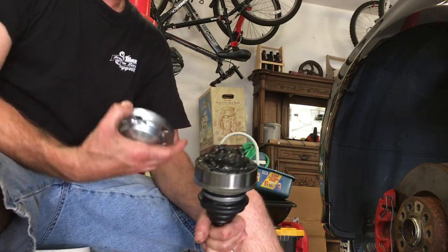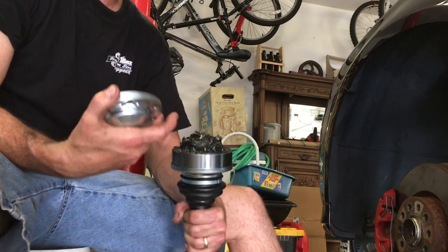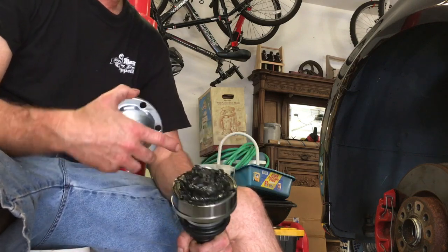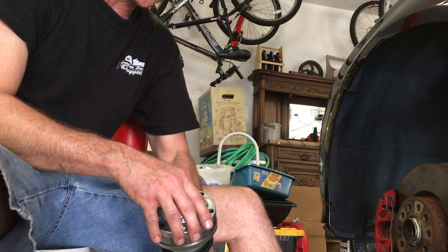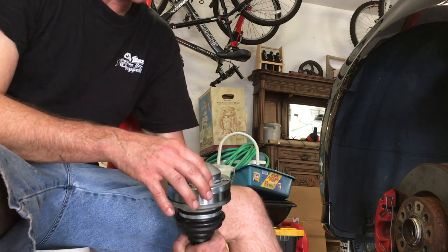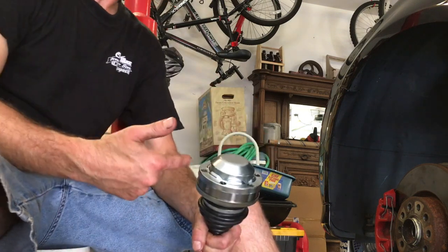I then took the bolts and came through and pushed the blobs of grease out of the bolt holes and wiped those off so it's mostly out of there. Stuck the little gasket on there and then put the cap on. Just lined it up. Unfortunately, none of that recorded, but there you go. In 10 seconds, you just got it all anyway.